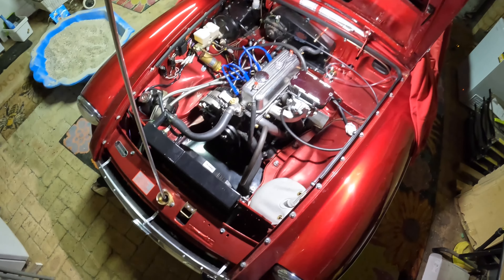Today I put the 32/36 back on again, set everything up, put the original distributor back in, put the original plugs back in, started it up, and it runs like a dream. I then sucked on the servo pipe and I could have sucked from now till doomsday and would not have got any vacuum in the servo. The diaphragm in the servo has gone — got a crack in it or whatever. I've never had an issue finding that problem before, so this was a bit unusual.